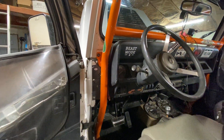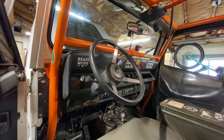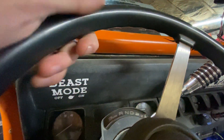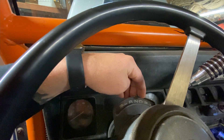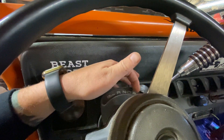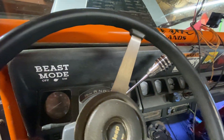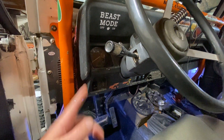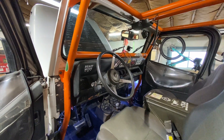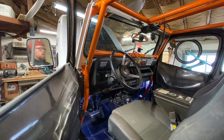If you didn't know, I did an AW4 transmission swap - it came out of a Comanche or a Cherokee. That's a transmission computer down there. I had to wire that into the ECM. I switched from the three-speed and now I've got Low, Two, and Drive - that's the same number of clicks as the AW4 has - but Low is first and second combined, and Two is actually third. So I can't pick first or second gear individually. But you can wire a switch into that computer to flip it up for first or down for second, which is helpful when you want to stay in a particular gear, because if you have it down in Low it'll shift when you don't want it to.